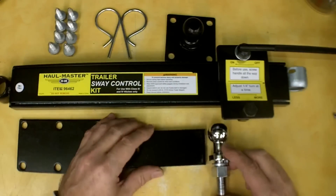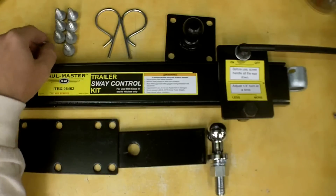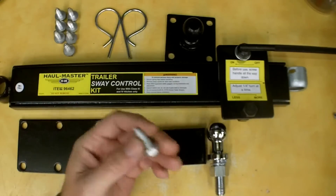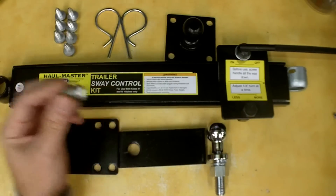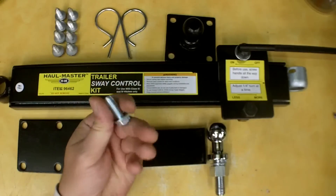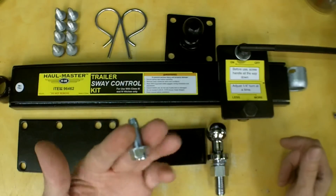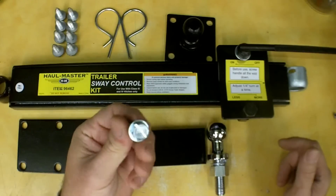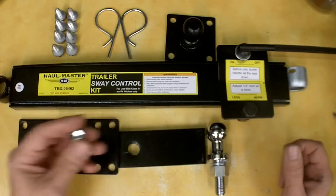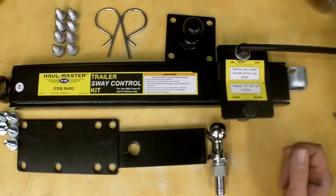The quality on it seems to be okay with one exception. I was reading some reviews and there were many people complaining about these self-tapping screws — well these are not. They just do not look like very good quality. People are snapping them off in their trailer frames trying to get them to thread in there. So I went over to Fastenal and bought eight of these self-threading bolts. I'll need to drill a hole and then there's a thread cutting piece on the end, so these are a better quality. I picked these up for 74 cents a piece — eight of those. Anyway, that's the only upgrade I'm doing to this because I do not want to run a risk of snapping one of those off in there and having to deal with that issue.